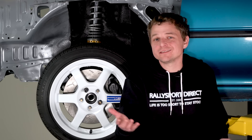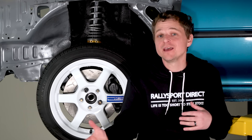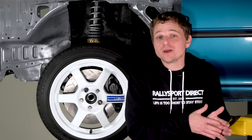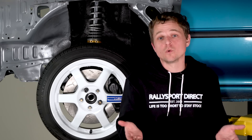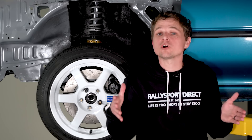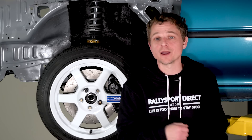One last reason is the rally tires are tall — they're 25 and a half inches tall. The taller tire will help reduce friction loss on the salt, but every inch of tire that we gain, the car goes up one half of an inch. We'll get into aerodynamics in a later episode, but we want this car to be as low as possible to the ground to improve airflow around it.